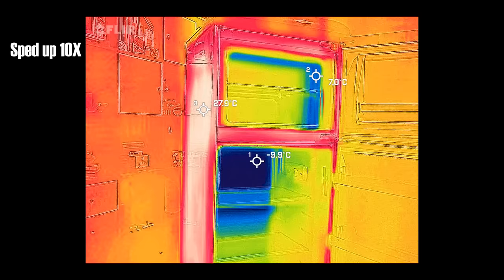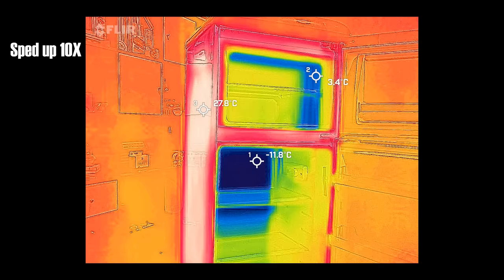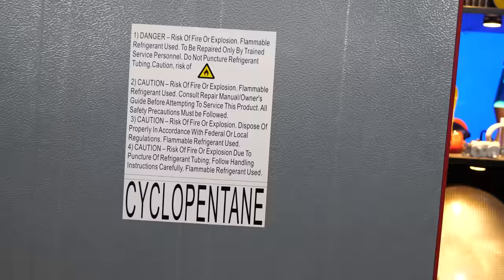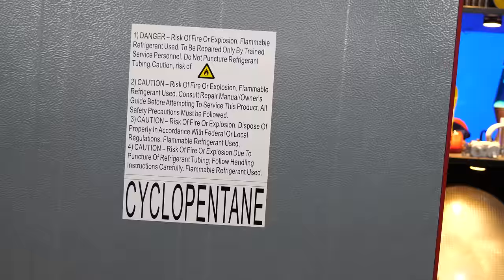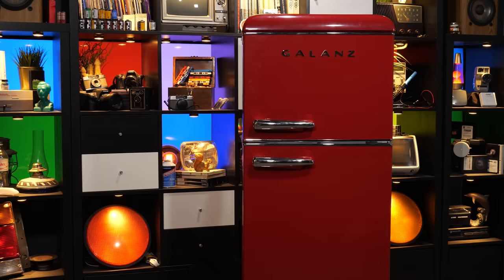However, they were clever enough to make sure that the front of the freezer gets that cooling first, helping ensure areas near to the vulnerable door seal get chilled immediately. Still, I would imagine that having the correct refrigerant charge in here is pretty critical for proper operation. There's actually very little refrigerant in this system — barely over an ounce of R600A. Which, fun fact, is explosive! I'm not planning on setting fire to it so I don't really mind, and besides there's hardly any in there, but with such a minuscule charge, I can only imagine that the tiniest leak is going to cause enough capacity loss to where the freezer section basically just doesn't work anymore.